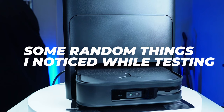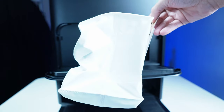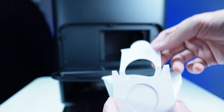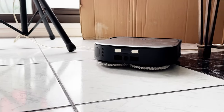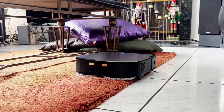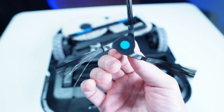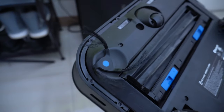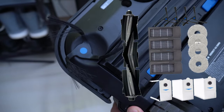Here are some random things I noticed with the X2 Omni while testing it. First is the bag, which uses a cardboard insert — one issue is that it easily bends if you try to reattach it. Not an issue if you're using it once, but something to note if you want to reuse the bag. The obstacle avoidance system doesn't seem to work during the mapping run, so clear any cables around your home before deployment. Also, the robot doesn't shut off the vacuum motor during the mapping run, so if you want to maximize coverage, use the lowest setting. I'd suggest buying extra side brushes and bags — after a few weeks of use, the side brush bristles were already bent.